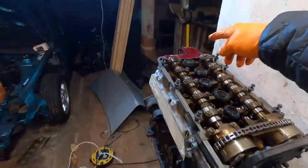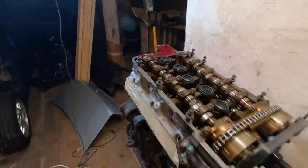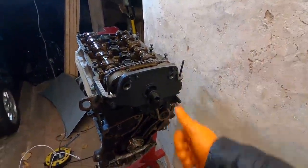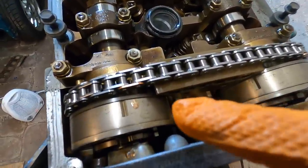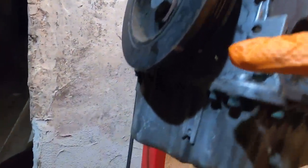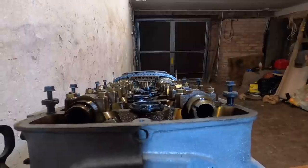Now we're gonna go ahead and pull the lockout plate out, rotate the engine around 4 times, and check to make sure everything lines back up on the 4th turn. And if it does, we did it right. So I've gone through and marked everything with gold nail polish. Gold is a bit easier to see. Gold down there on the tooth. And then over here on the crank, we have our line right there, the notch on the inside, and the one on the block.